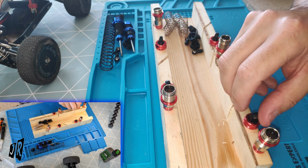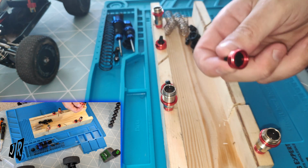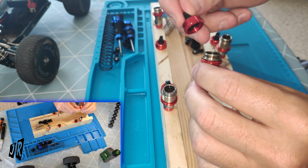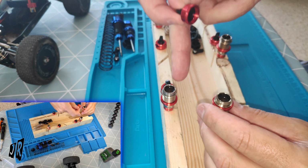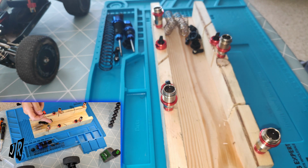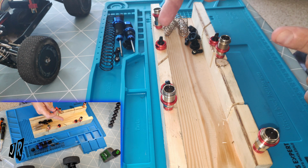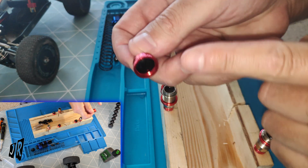So, right, now each of the caps has the little rubber bladder type thing. It compresses in and out. Now, as you put the cap on and tighten it up, it's supposed to just expel the air slowly, and then the last turn is supposed to seal it properly. So it will make a difference what sort of amounts of fluid you've got in. Logic to me, because I'm that type of person, says fill it up with fluid and then all the fluid that you don't need will leak out. But then of course I have noticed on a couple of shocks along the way where it's now rock hard, it's not moving because this little bladder thing is not able to do its job.